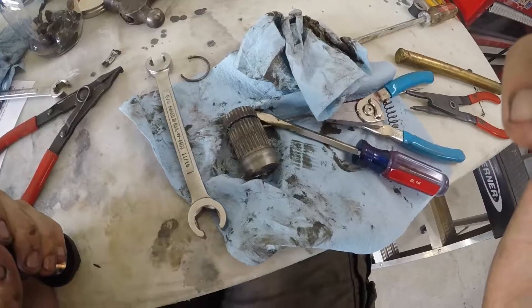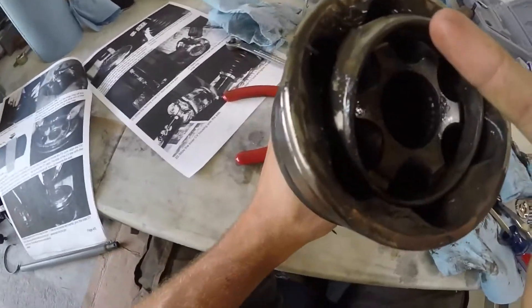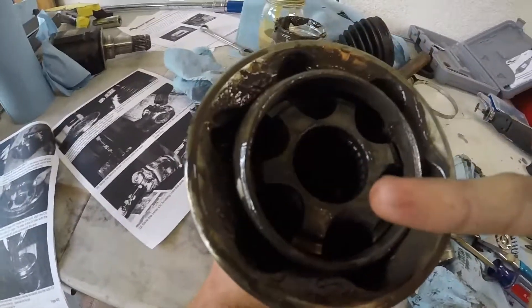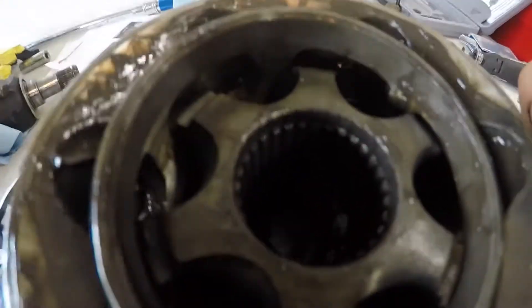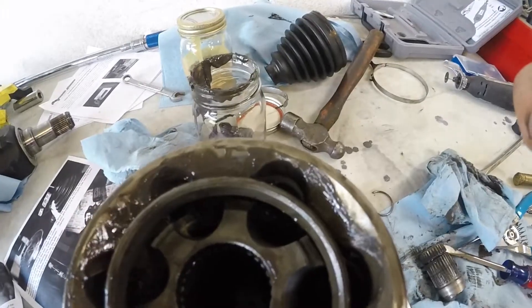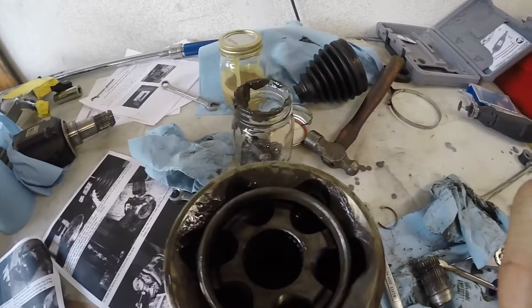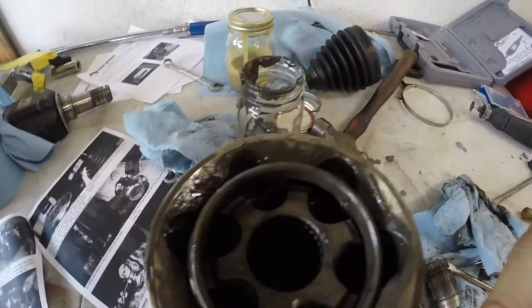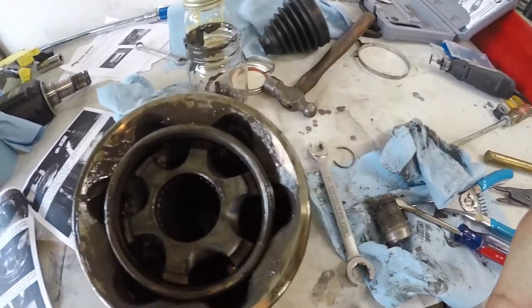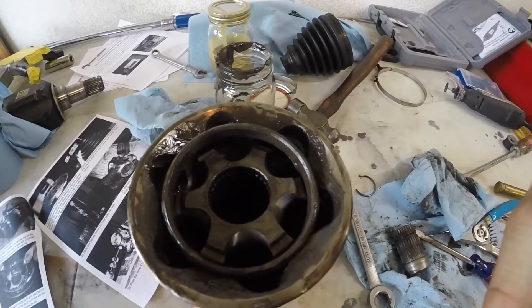There's the little axle stub that was cut and the snap ring that came off it. Put your cage back in with that open larger-diameter side facing up toward you so you can get the star in. On the star itself, the section where the splines are machined off faces up toward you, so when you put the new axle shaft in and reassemble the ball bearings, the snap ring on the new axle can compress over the splines and snap into place once it goes down far enough.